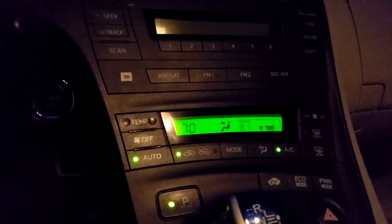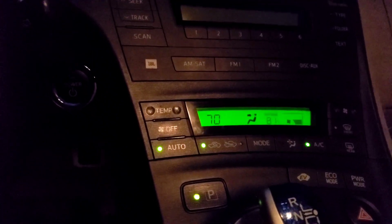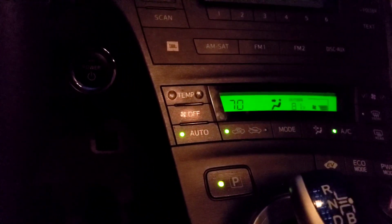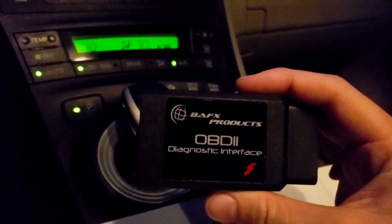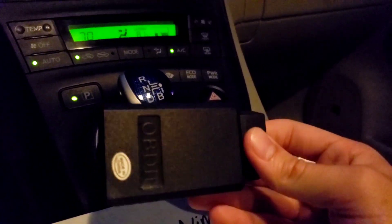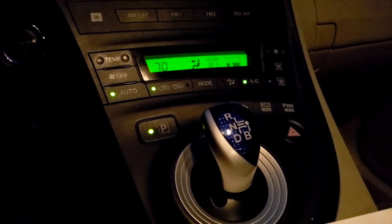You're probably going to be closer to sucking up a temperature of 75 or even 80 degrees, depending on if you've been parked outside. In a bit, I'm going to show you what app you can use to monitor both the air inlet temperature and your battery temperature, as well as monitor your discharge and charge limits. It works in tandem with an OBD2 reader, which I got on Amazon for $20. It connects via Bluetooth and supports about two reads per second, which is plenty to run the hybrid battery fan and make sure our battery is at a nice cool temperature.